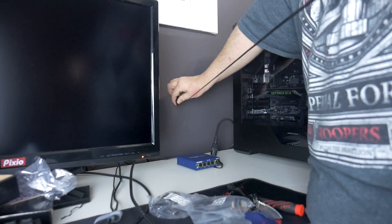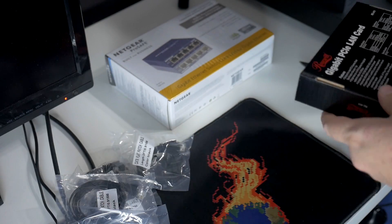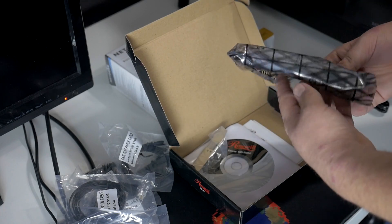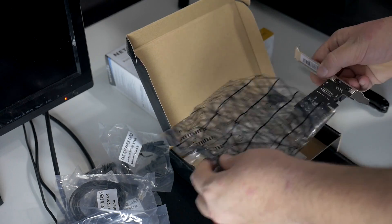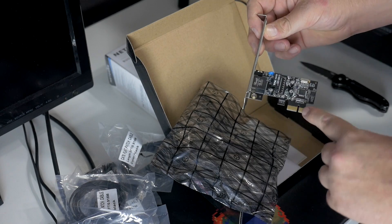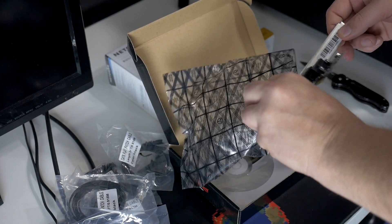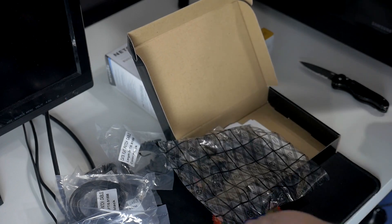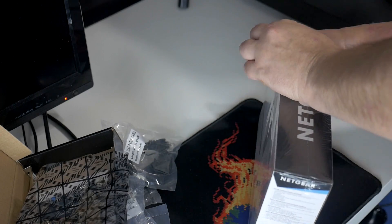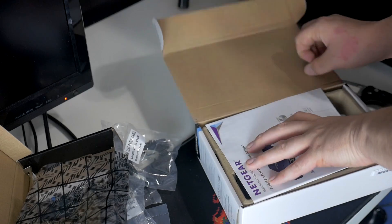The cable under the house is a flat CAT6E cable, 100 feet long, and that was only $16 — Ethernet cables have really come down in price. Here's our PCIe LAN card — pretty simple, pretty basic. Don't touch the gold connectors. If you want to be extra safe, you can use a wrist strap to ground yourself personally. I'm wearing socks on a carpet right now, which is not something I advise anyone to do. I'll link to all of this stuff down in the description below if you need to pick up a PCI LAN card, PCIe card, or a gigabit switch.